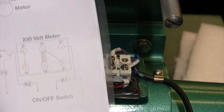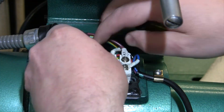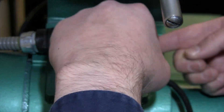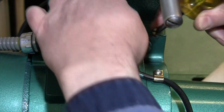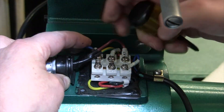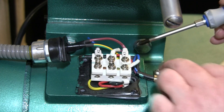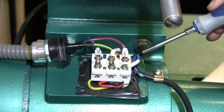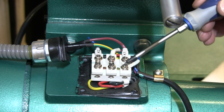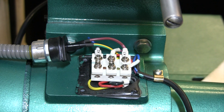We're going to wire this up with K2 over here on Z1 and K1 on U1. K2 is going to go back over here and K1 is going to go on this end — that will get us wired for 230 volts. Let's get them plugged in. Just about ready to turn this on. If you're not wiring in a new motor like I am, but just making an adjustment on the existing one, then you may not have to move these wires — but this is what tripped me up. Mine did not come in the correct position, so I did have to put these in the right position. For the ground wire, I'm just rewiring that back to the case in its original position as well. We've got K2 in place, K1 in place, the ground wire around the back. There's a little rubber gasket — I made sure it was underneath that and has good contact with the housing. We've got our jumper in place for 230 volts, and our capacitor wire is going across the right direction. It's my third time doing this — feeling pretty good that I have got this wired up right.